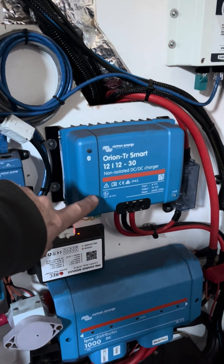For the lead acid side of charging I had to use a DC-to-DC charger. But for a lot of modern engines that side of it would be simpler — twin alternators, and the second alternator on a modern engine normally runs on a poly V belt, so you see serious performance and really fast recharge times in the winter.